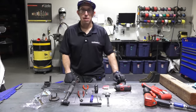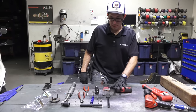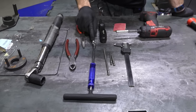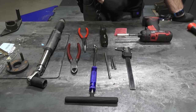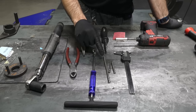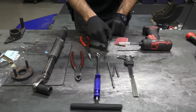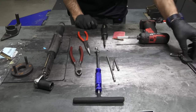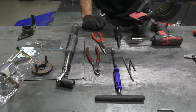Here are the basic tools you need for the belt job alone, without taking apart the driven pulley and replacing the grease and seals. You need some sort of 8mm driver to get all the belt cover bolts off — an 8mm wobble makes the job a little easier, or you can just use a small ratchet. Many fasteners on these new Vespas are Torx, mostly T25 and T30. You're also going to need a number 2 Phillips driver. If you're going to reuse the belt, you may need a dial caliper to measure the width, though generally you're going in there to replace the belt or the roller.